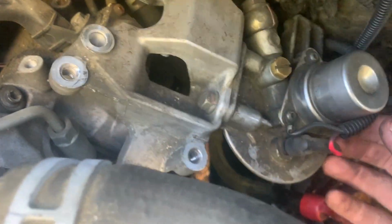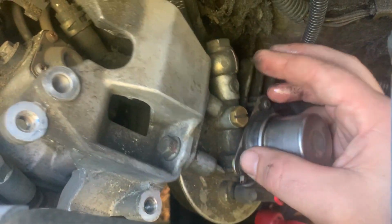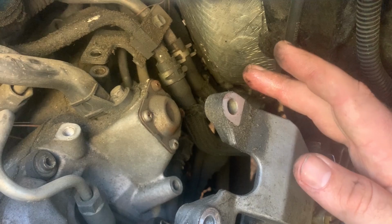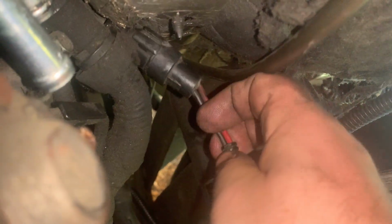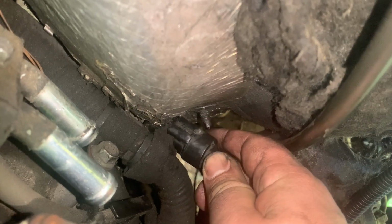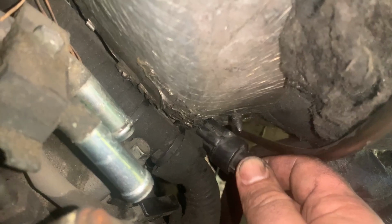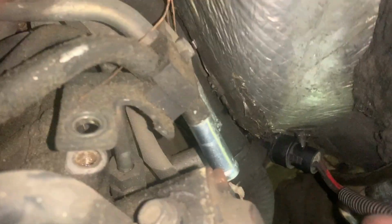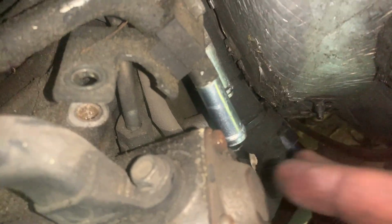Oh, and you definitely will have to remove the filter to get this off for sure. But yeah, so we're gonna try to save these banjo clip bolts right here, the seals. Get that side off and put new hose on while this goes back together. That's coming out for this particular little service. Looks like they're both 1/2" lines. The weird thing is this plug, I'm sure it's somehow, can't quite see how that comes undone. I tried putting a probe in there and pushing it, pulling, but I'm not sure what I'm pulling on either, because it's kind of a weird spot to get two hands back there. So what I ended up doing is just disconnecting the other side and leaving it plugged in. Note, it's 1/2" size hoses over to the filter housing on these trucks.